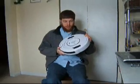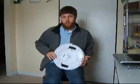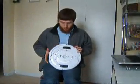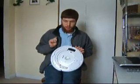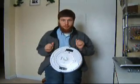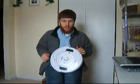What is cool about Roombas is that they have a serial port on them, for which you can give them serial instructions. That means one after the other. If you get a brand new Roomba from the store, you won't be able to see the serial port because it's underneath a protective cover that you have to pop off and feel like you're breaking it, but you're not, unless you do. But you don't, and then you're good.